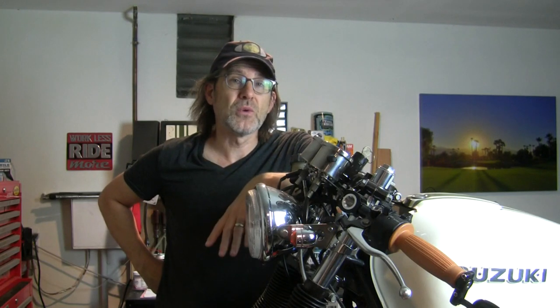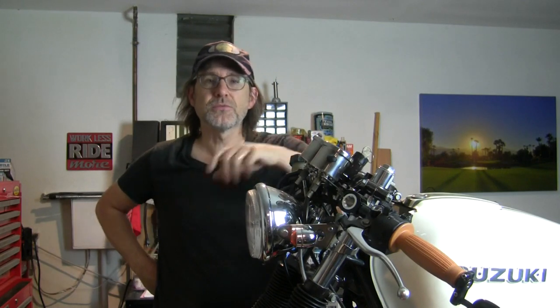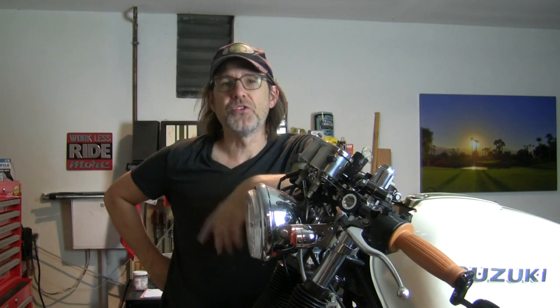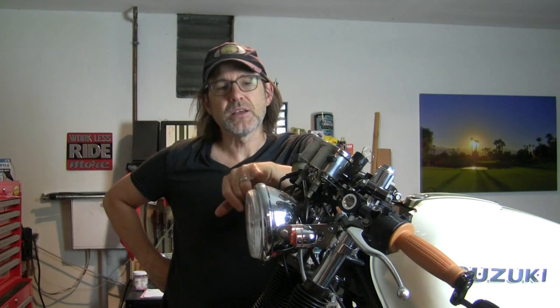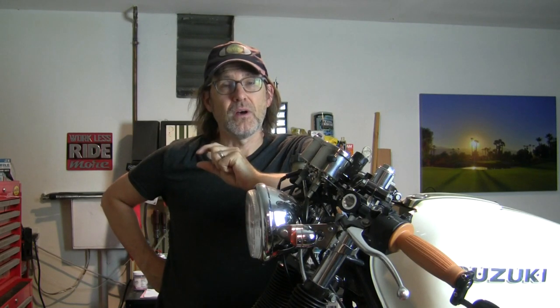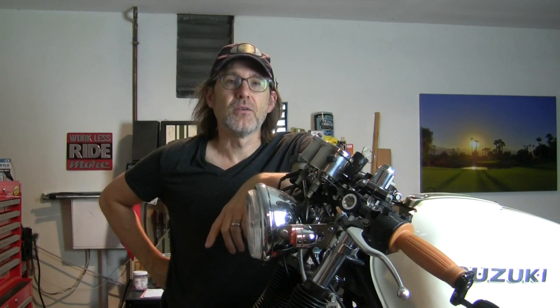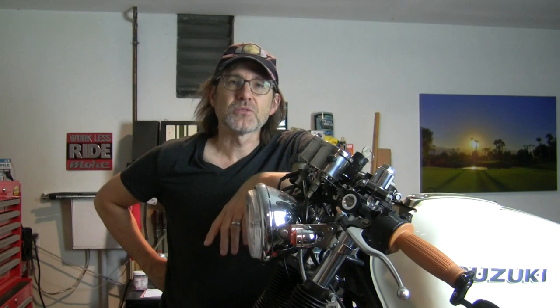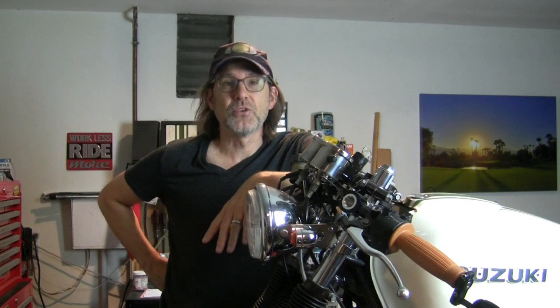And so I shortened my original cables, and that worked out fine in the case of the throttle cables for me, but I'm going to pull down my previous video on shortening the clutch cable because the ferrule on the end of my job has come off twice due to the resistance of the springs and the mechanism in this clutch. And you know, what if that had happened while I was riding? So at some point, in some cases, if you've got budget too far forward on your priority list, you can run into trouble. So that could be a safety issue.